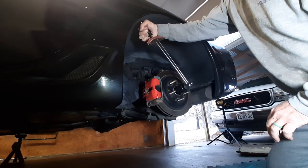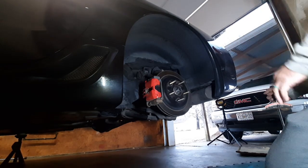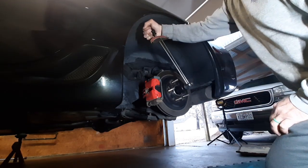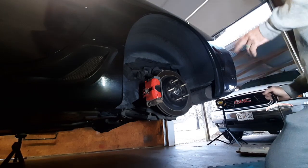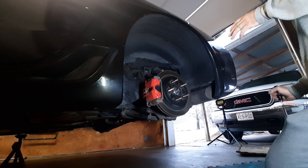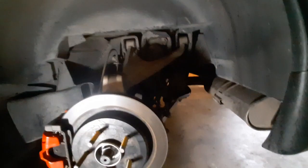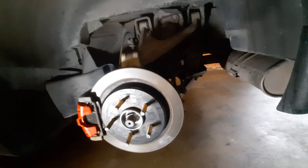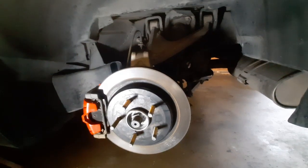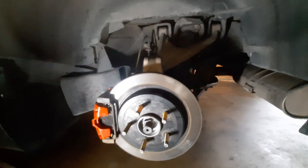When these differentials are new, the clutches are new, that breakaway torque should be 100 plus foot pounds. This thing has got 200,000 miles on it — I knew the stuff was going to be worn, so I already have parts coming for it. This gives you an idea of how bad it is. There is a Belleville spring — a spring washer inside the differential — that puts preload on the clutch packs. In the C5s that Belleville washer is kind of small and weak, tends to break, and then you lose the preload.